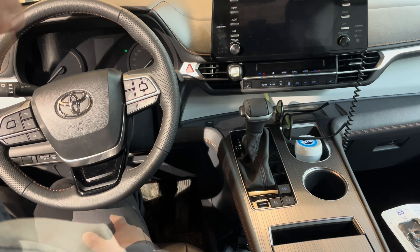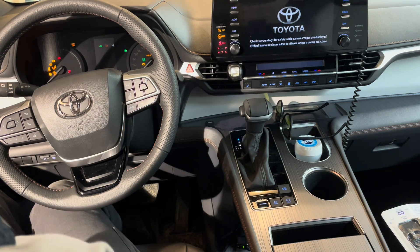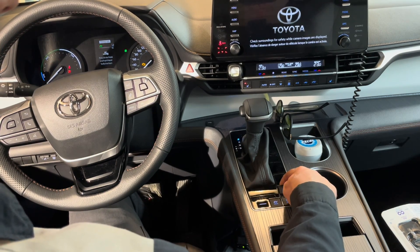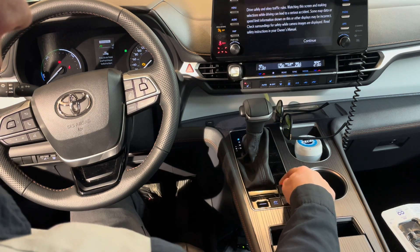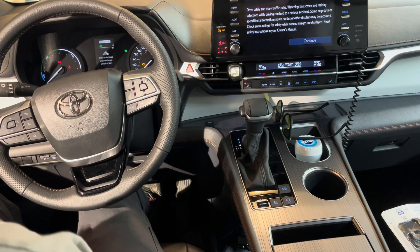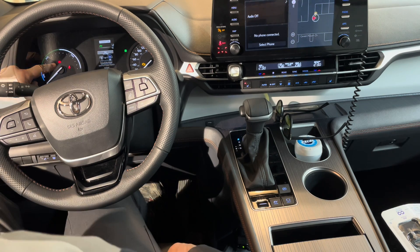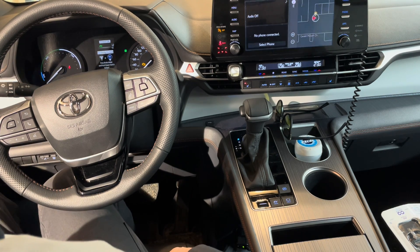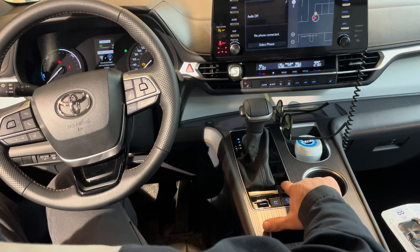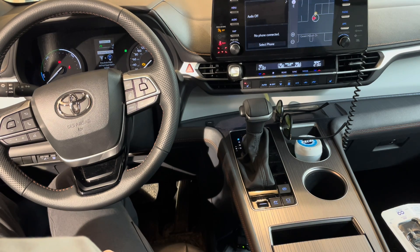So let's try it right now. Foot off the brake, press the power button twice to turn the ignition on. Now foot on the brake — pull one, two, three. Now push one, two, three. Note that the parking brake light is flashing rapidly. Now take your foot off the brake and push and hold the parking brake button for five seconds. The motors are retracting now.